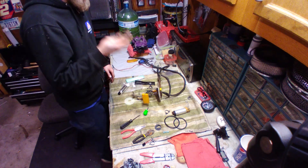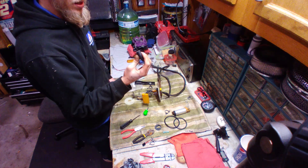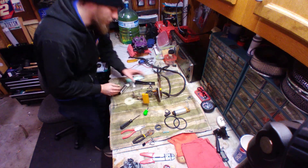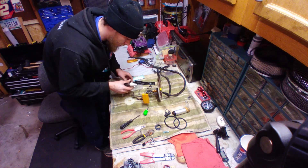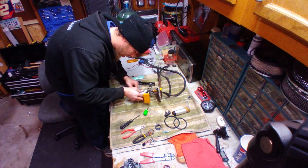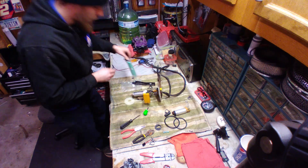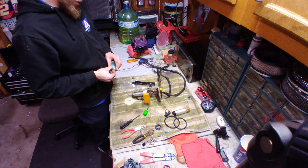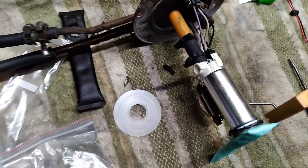Correction — we're not using the new hose. Like you can see, it's a smaller diameter inside, and it's already chunking some rubber. I don't want that ending up in the fuel system. So nothing's wrong with the old one, we'll use the old one. Put that up in there, like so. Got our new fuel filter sock — sleeve, shoe. Alright, we're back together. Got our new filter on, new pump. About to drop this thing back on the tank.